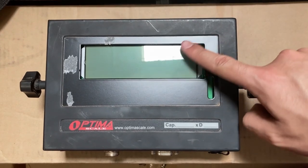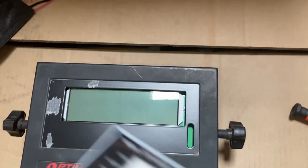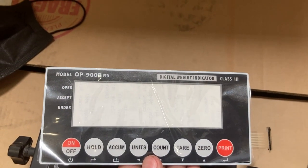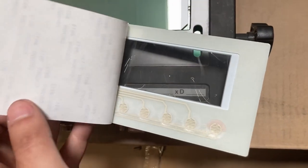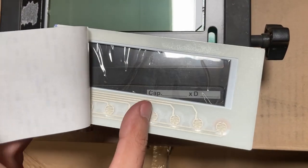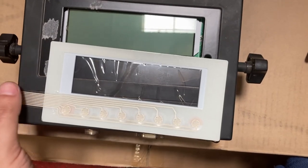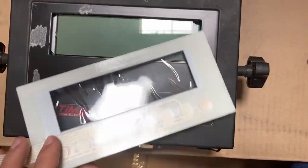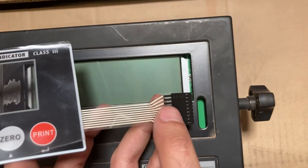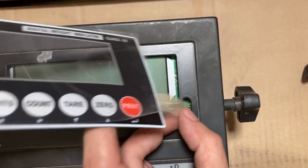This is my old keypad, so I'm going to take my new one and put it on. You can see a closer look — this is where the keypad will go, and this is where the tan cable will go into. Take your new OP900 keypad, remove the thin film from the back, and remove the tape from the keypad. Make sure there's no leftover adhesive on this side — it's all clear. Turn it over and take your black end and place it within the hole to the right of the green board.